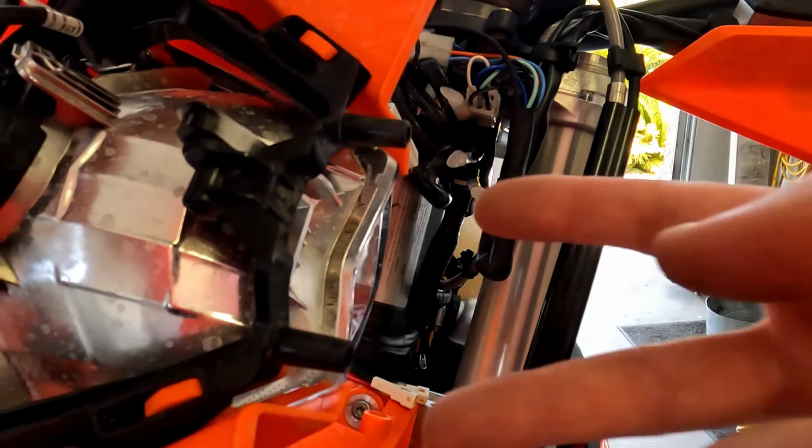All right, got that one. Snap these connectors in to their holders. Just make sure you got that excess cable pulled down here out of the way, and keep those wires nice and tight up here so that they don't interfere with that seat hook that goes back here. That way everything's just as discreet as possible. Get that ECU snapped down. Let's get our seat back on.